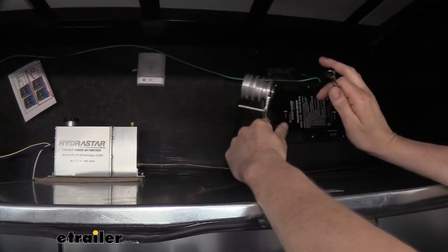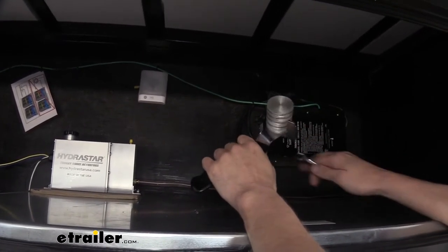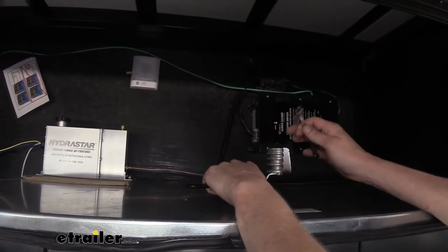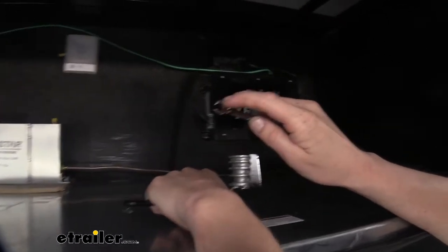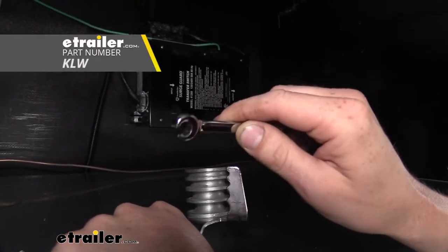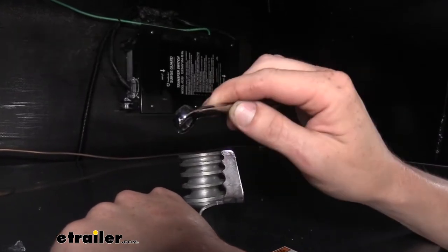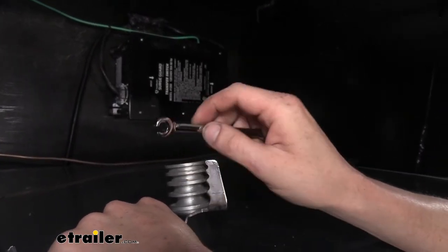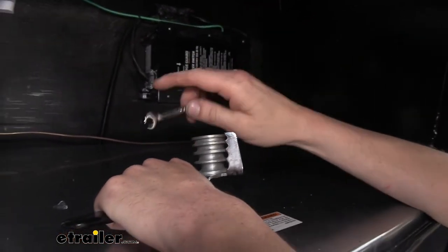There are a couple of tools we're going to be using along the way. I highly recommend them — they're pretty much required if you want a nice layout for your line routing and a wrench that's going to be able to tighten them down enough with the 1600 psi of pressure we've got. These are line wrenches — you can tell because there's just a small opening and a lot of surface area to contact on the nut. You need this when tightening down your lines because a regular wrench will just round the nut off. It's made of a softer material in order to seal properly, and that softer material requires this extra surface area to get it torqued down properly without damaging the nut.